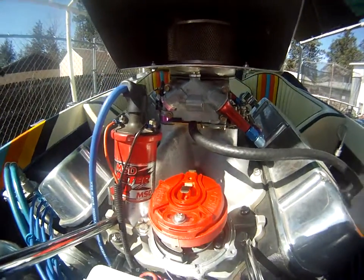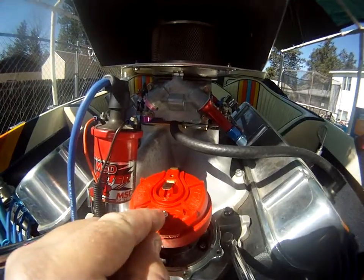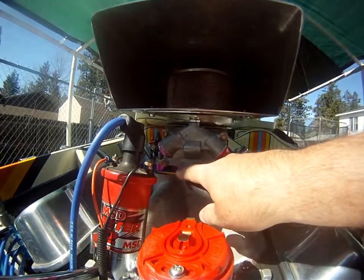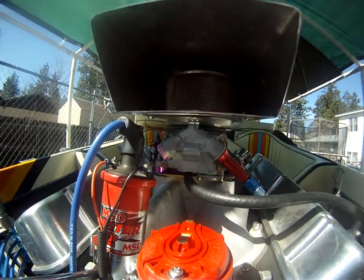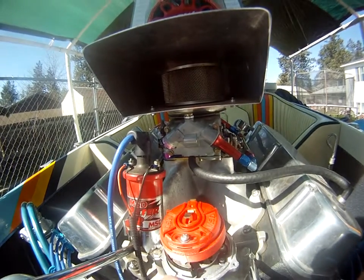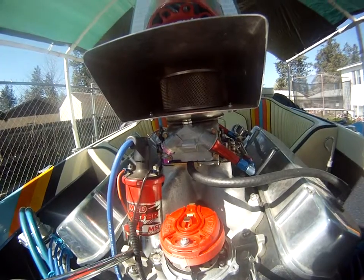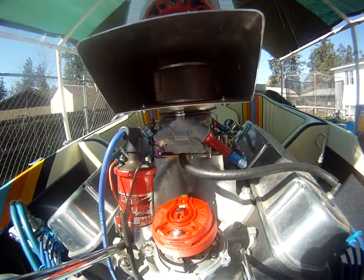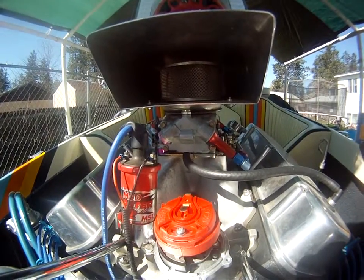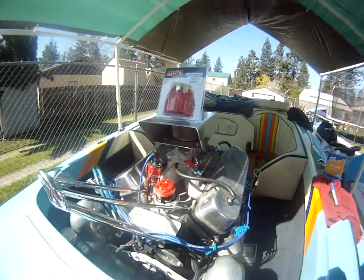That's how you phase the rotor using the 30-degree method — it's really easy. Just loosen that screw, turn it, phase it to the 30-degree dot that we made earlier, tighten everything down, and put it together. I'm going to loosen that screw, point it to that direction, and we'll check where it's sitting in the cap based on our locations. That'll be in my next video. That's all there is to the 30-degree phasing.